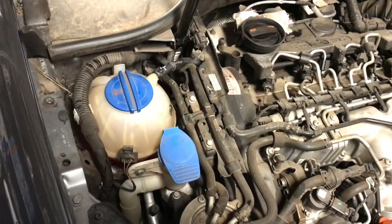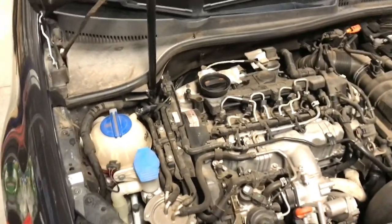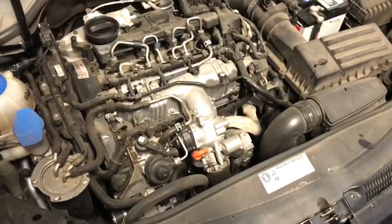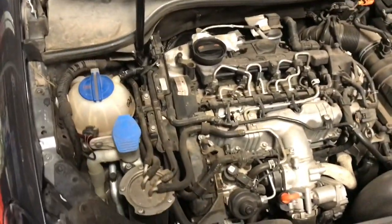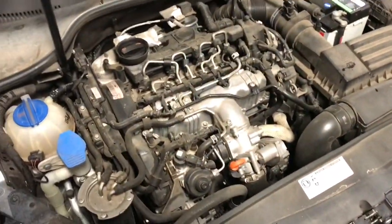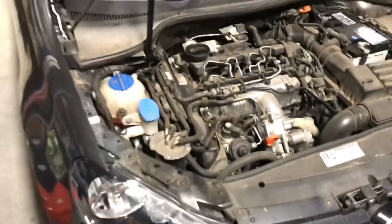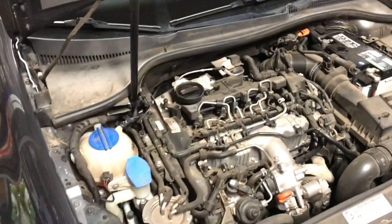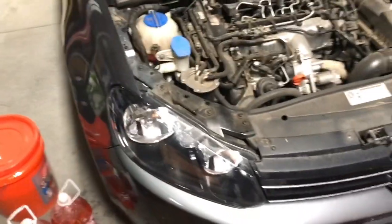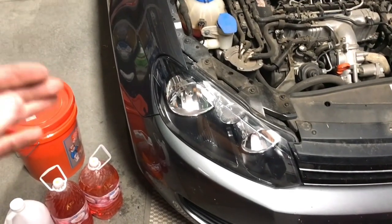We're done — that took quite a while. One thing I definitely messed up: I started with a cold engine and wasn't thinking about the thermostat. Of course the thermostat isn't going to let half the system's coolant through when it's closed. So start with a warm engine, and you might even want a second person on the throttle holding it at around 2,500 RPMs to keep it hot so the thermostat opens more frequently — that'll help you exchange coolant much more efficiently.